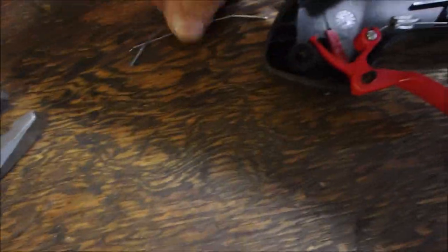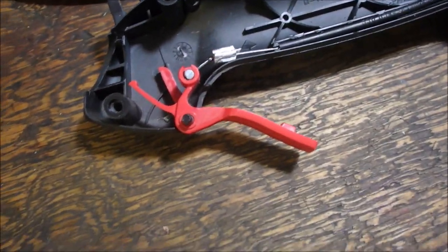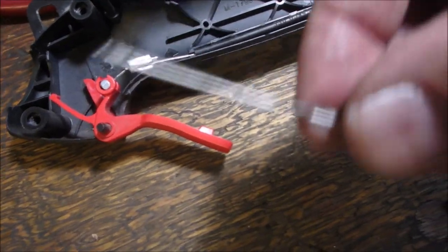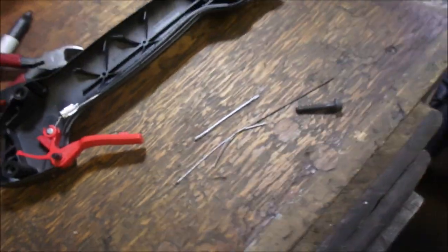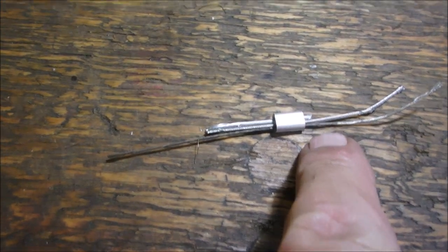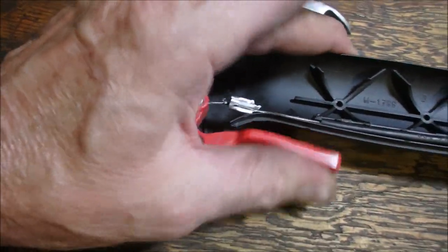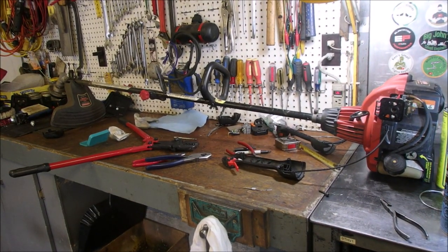The swage — or the little connector — is for 16 to 16. So I thought maybe in one slot of the little guy we would make the two wires into a 16, and then the other end would make a 16 and we could squeeze them together. Like that — there's a 16 gauge and then probably two 20 gauges. I squished it together and it works pretty good. I think we'll get away with it. And I pulled on it as hard as I could with the big pliers and it didn't separate.